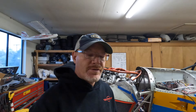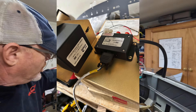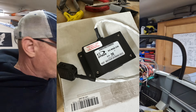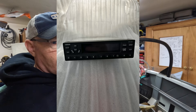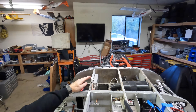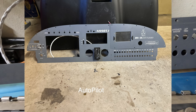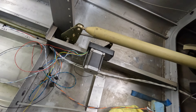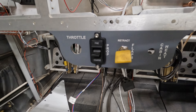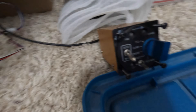I'll show some of the avionics. I basically have a Dynon Skyview, brand new in the box — it has been wired, so there is a harness for that, all wired in already, and it will go right here. Then we've got an Icom radio, a Garmin 327 with the ADS-B out box over here, and an intercom. It does have autopilot with the Dynon autopilot control and the Dynon autopilot servo. This is the pitch servo — the roll servo is in the wing. It also has a prop control with pitch adjustment here and the Air Master control.